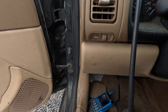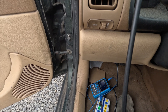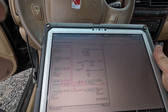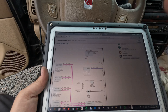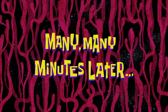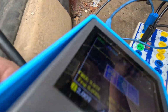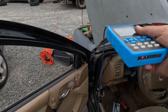Looking at the diagram, we'll try to crank it with the scope in — starts and dies. There's no real communication on it, so something's probably shorted and some module is probably bad. Usually there's a bar that splices the wires together, typically under the dash, so we'll look there. Many minutes later — I can't find it.